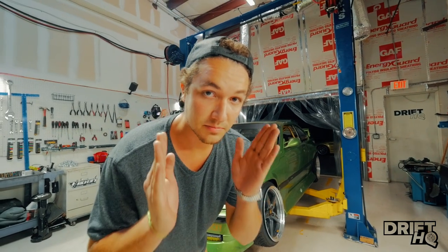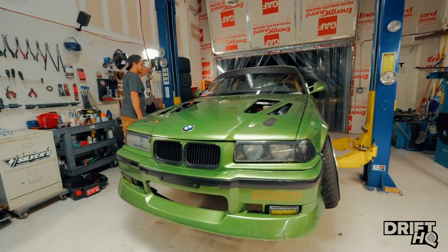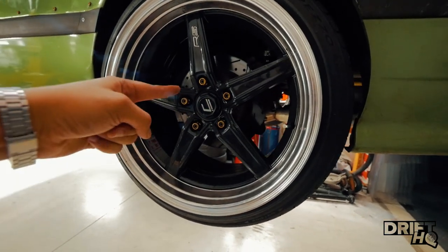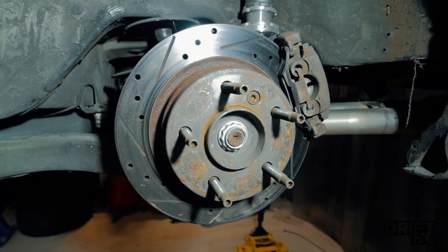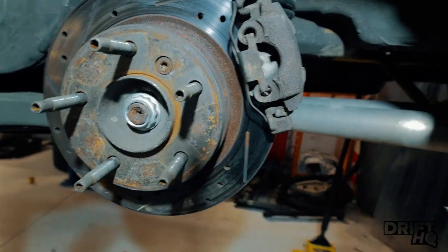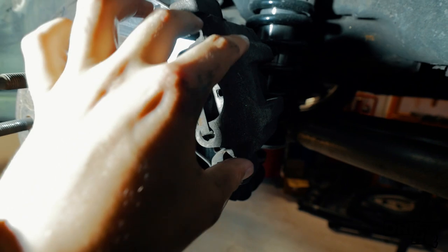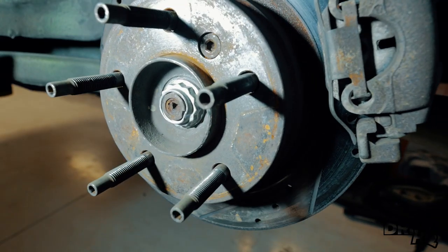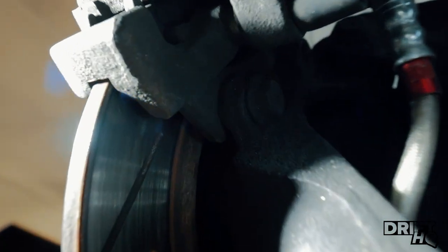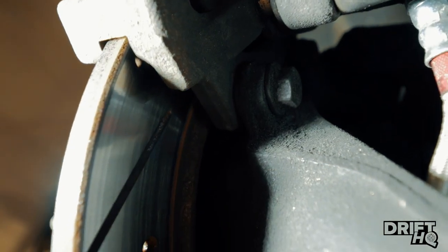Never lower your car as much as you want to — it looks great but does not go on the lift as easy as it should. We'll begin by taking off the wheel, that's step one. Quick walk around the setup: I have Truer coilovers in the rear, adjustable arm, still have my spring perch and non-M caliper with a drilled and slotted rotor, really rusty, and I have stud conversion on the rear. We'll start by taking off the caliper, held on by two 16-millimeter bolts, really easy to access with a ratcheting wrench.